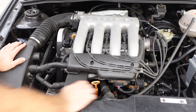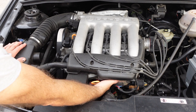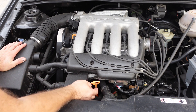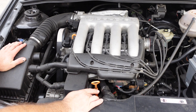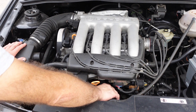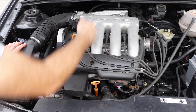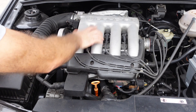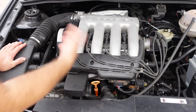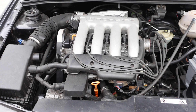Here's the Mark 3 in question, and there is the flange we've got to do. As you can see, it's tucked up under the inlet manifold. To get access to the bolts you have to use a wobbly five mil allen key, and you're more than likely going to round them off, and then you're going to have issues - or you could actually snap the bolt in the head. So it's a much bigger job but a safer job to remove both parts of the inlet manifold, and that's why we're doing the port and polishing at the same time.